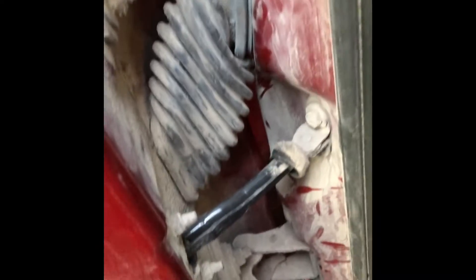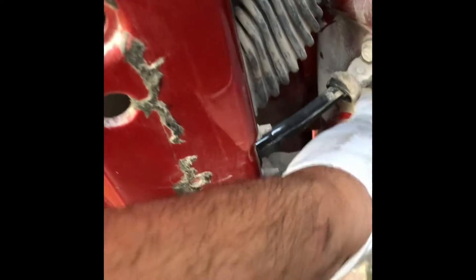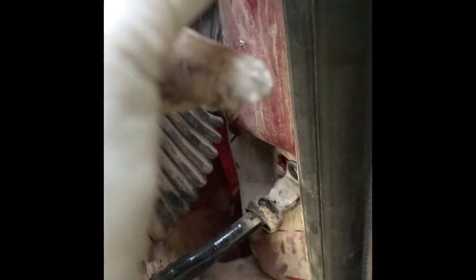I'm going to replace my door. I'm removing this 13mm bolt — one, two, three, four — and then this stopper, which uses 10mm bolts. Then I'll remove the wiring here. You can just take this off and disconnect it. Got these two 10mm bolts out for the upper part.